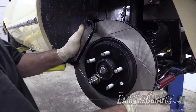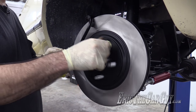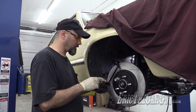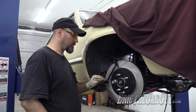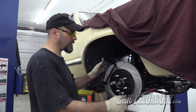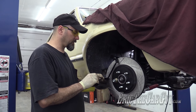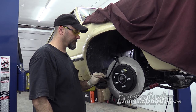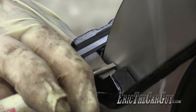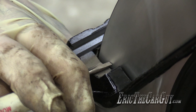It's not on there all the way. Not round — it's either the hub is not straight or the rotor, one of the two. You can clearly see that something is not right. Now it could be that I don't have the wheel bolted down and it needs the wheel bolted down, but it's way off. Here's another mystery that got solved off camera: after bolting the wheel down, this rotor came out straight and true. So it was just some strange anomaly — maybe a little something between the hub and the back of the rotor. But once the wheel was bolted down, everything was fine.